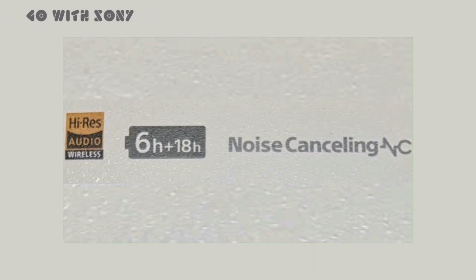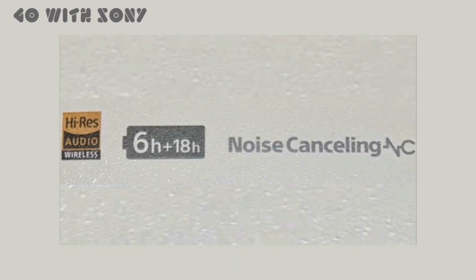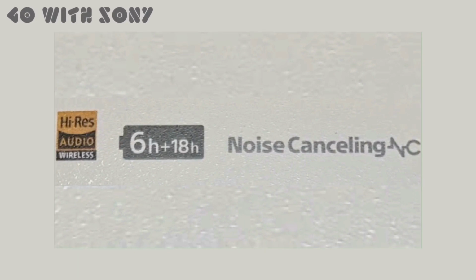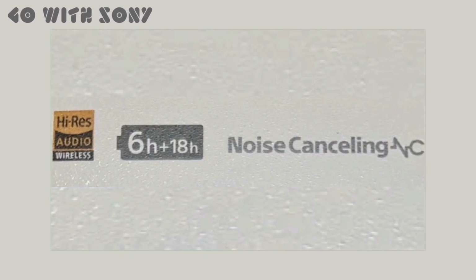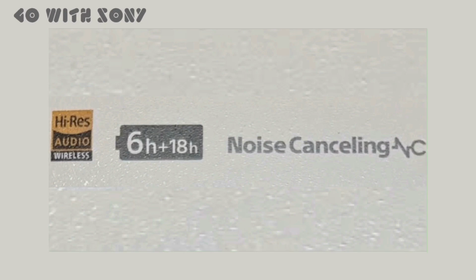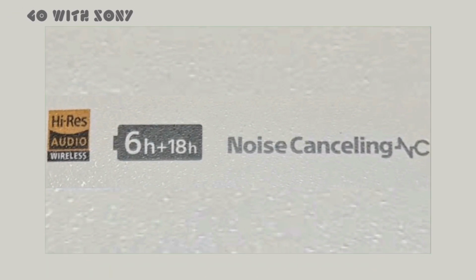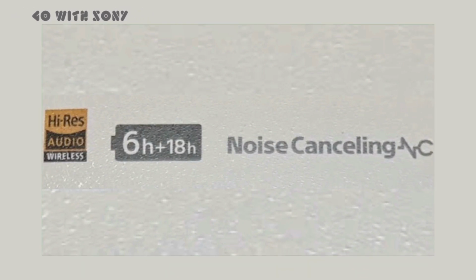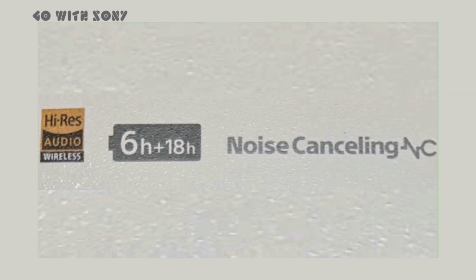The product page for the WI-1000XM2 mentions maximum 9 hours with NC on, maximum 10 hours with ambient sound mode, maximum 13 hours with NC off. This does not correspond to anything from the guide, so a bit confusing. Comparing playback with LDAC and AAC and NC on, there is only a difference of 0.5 hour on the WI-1000XM2. So perhaps LDAC playback will be possible on the WF-1000XM4, but I do not expect 6 hours, maybe 4-5 hours.